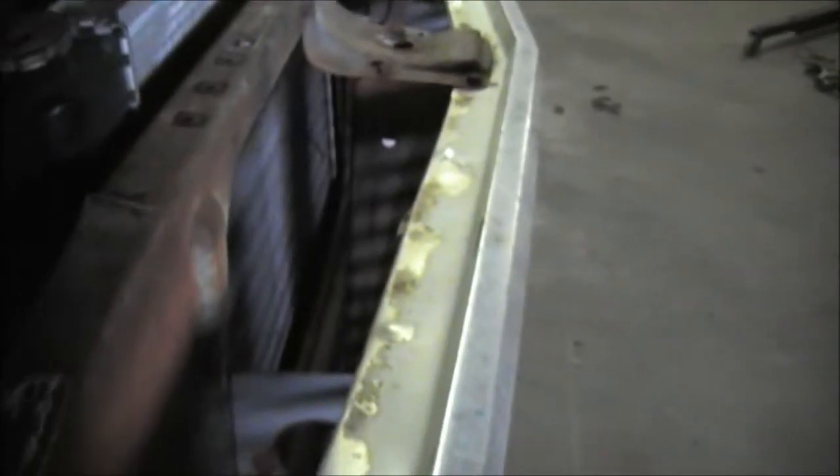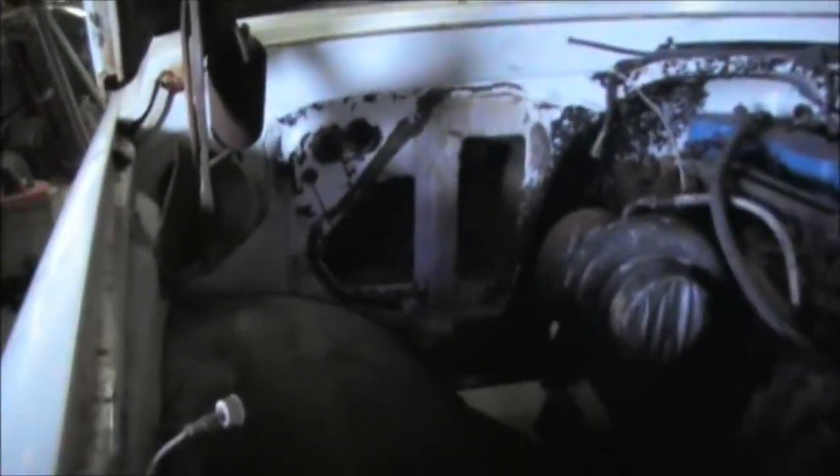Looking through the grill here — this aftermarket grill that's in it is an old one, it's rusted, it's going to have to go. The support there for the hood latch is going to have to be rebuilt so that the intercooler will fit, but outside of that I don't see any problems getting the intercooler in here. What I'm thinking I'll be able to do is put the intercooler into the core support — I'm going to cut it into it. And then I should have enough room left on the front where I can put in the condenser for the air conditioning. I think everything's going to fit really nice. As you can see, the turbo fits real nice and everything fits real nice around the Cummins. The frame is going to get boxed out right there to clear the water neck — that's not going to be an issue. You should have a really nice direct shot down into the water pipe going into the radiator. All that's going to get closed up with the vintage air system, so that's going to work really well.